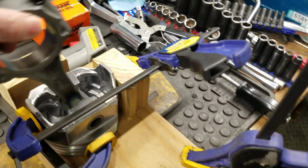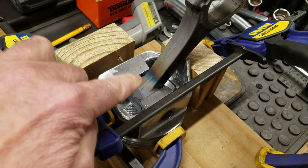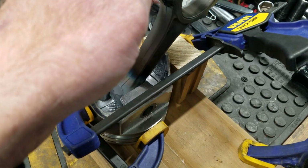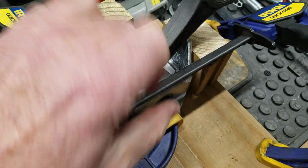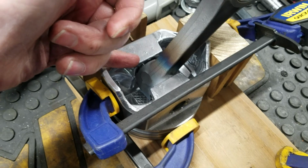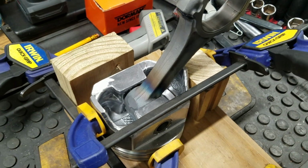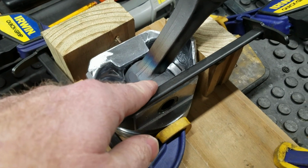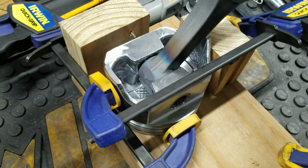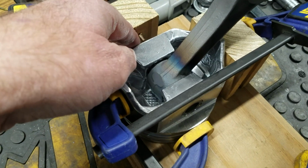And one other thing that I will say before I finish here, just about ready to finish up the video. You have to be careful, because when this thing is hot and you slam that all the way in, the actual rod is still loose. It can actually slide back. In other words, when you push that pin in, it's going to take the rod and put it right up against the side of this part of the piston, right? And then you slam it in, you're holding the pin there, right? And then you got this rod, and because it's able to move, if you're not paying attention, it can actually slide back over and hit the other side, and then your little stop over here is kind of useless, because now you're off. And then when you go to take it out of here and slide it back to the center, well, then your pin's going to pop out on the one side.